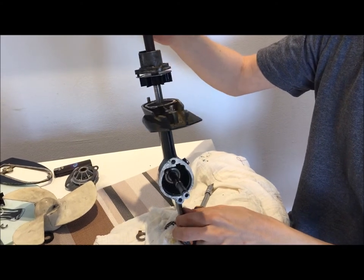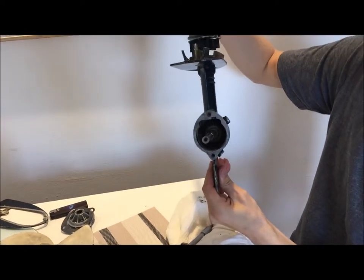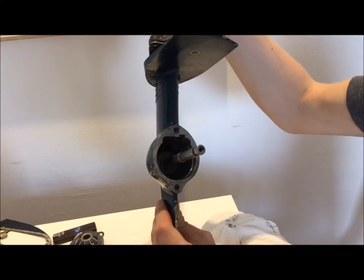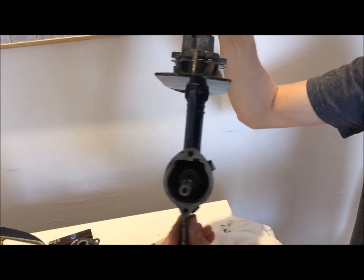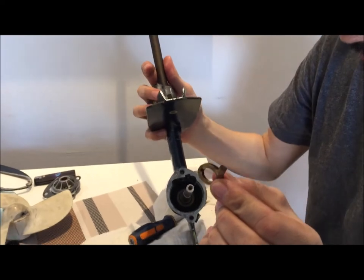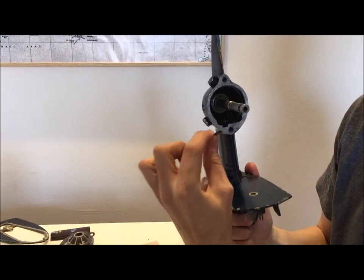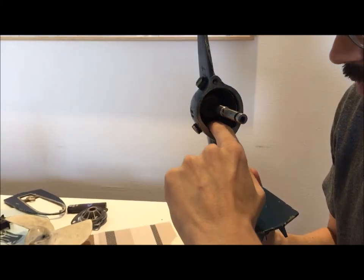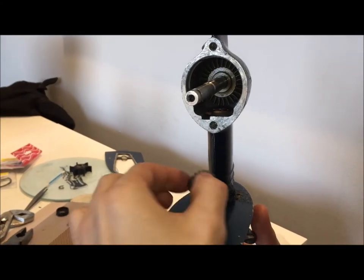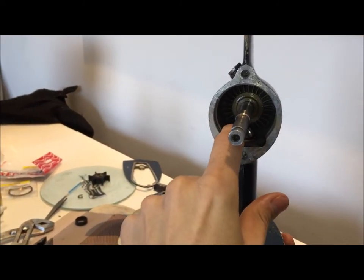Now that this is reinstalled, don't forget to always turn it clockwise. When you are going to insert the drive shafts into the gearbox, put back the washer. My advice would be to do it the other way around: put back the circlip first, and then the washer.